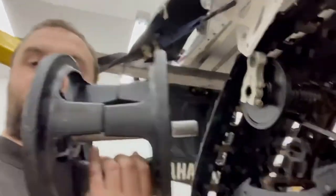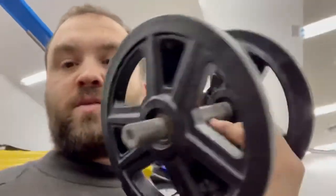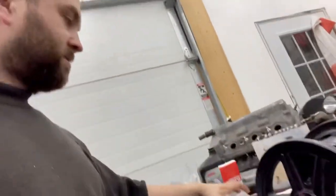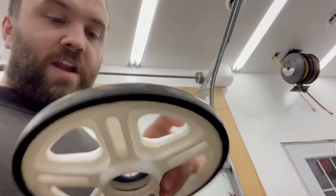So these are the rear bogey wheels in the back - the ones on the track right here, the inside band board ones. There are two on the exterior - they're normal 6000 series bearings, you can press those out. Unfortunately these ones here are cast in place - I'll flip the camera and show you. But these ones on the outside are just typical 6000 series bearings, you can press them out, you can do them by hand with some sockets and punch them out. Pretty simple, and putting them back in you can almost push them by hand.